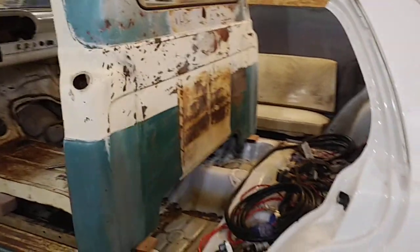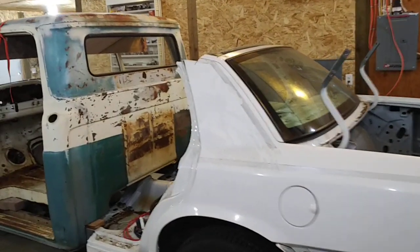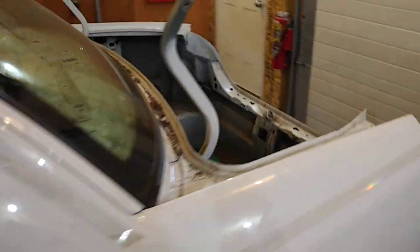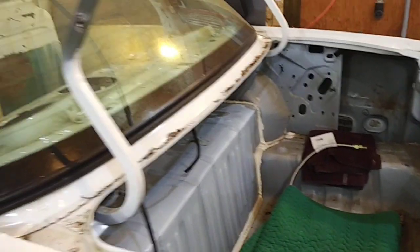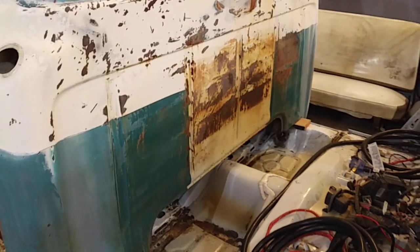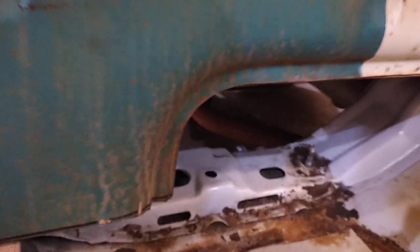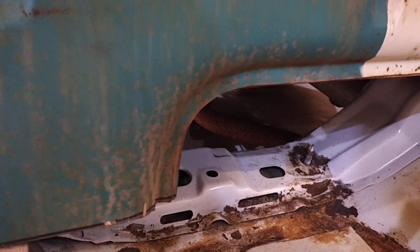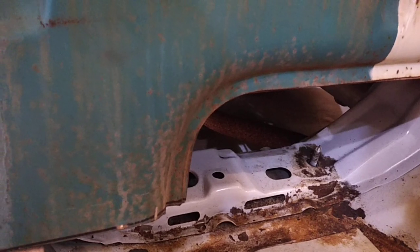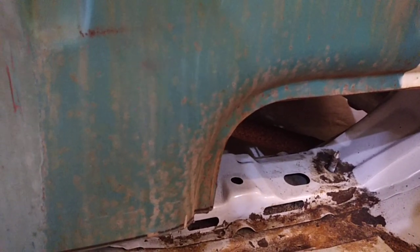I'm also taking a little bit different approach in the back of the vehicle. It looks kind of goofy right now with the Crown Vic rear end on here, but my plan is to keep the entire floor of the back area — the back seat area, the hump over the tank, and into the trunk — keep that intact, and that will form the floor of the step-side or flare-side box going on the truck. I've done this a little differently from most others I've seen — I'm going to be mounting the back of the truck right on top of this floor pan. The floor pan is cut off under the cab itself, but that cross member goes across to two cab mounts in the frame, so it's pretty sturdy right there, and I think I can just build off that and have the back part of the cab mount right on to it for a good solid rear cab mount.